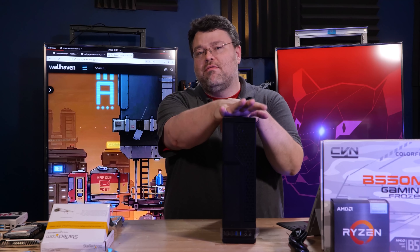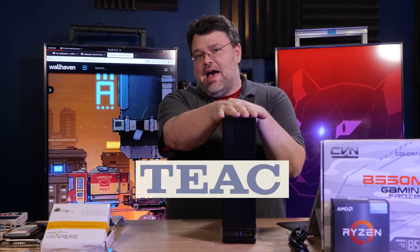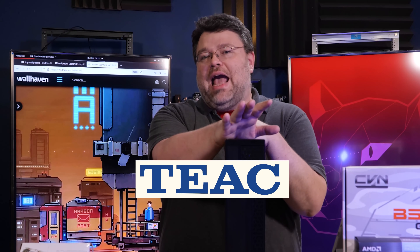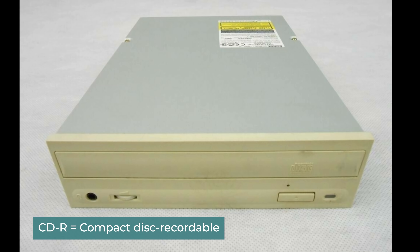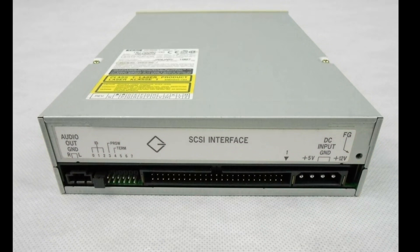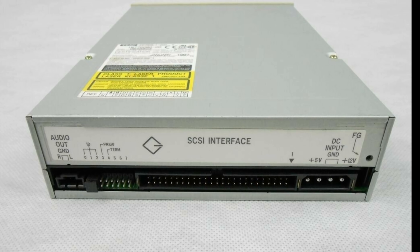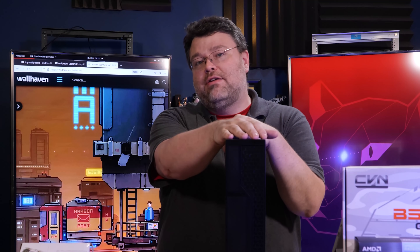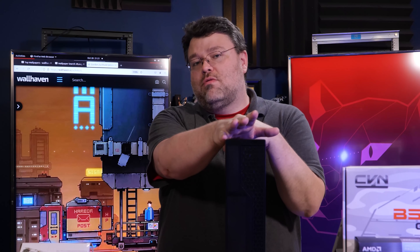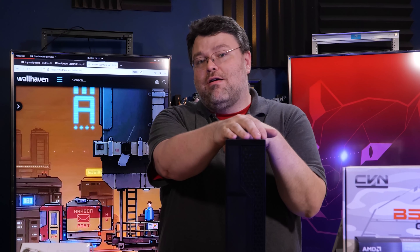Because this is going to be used for media archive including CD-Rs, I'm shopping around for new old stock Teac CD-Rs. Teac was the Cadillac of CD-burners — the commercial versions were designed to be able to process 10,000 plus CD-R discs. If you can find a new old stock one of those, they're great for CD burning. They're fast, reliable, accurate, and designed for mass production. If anything can read a damaged CD, it's going to be one of those Teac CD-Rs.